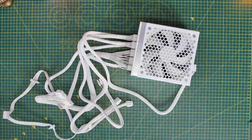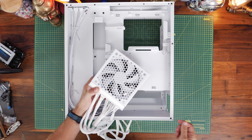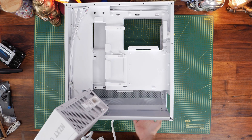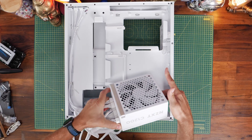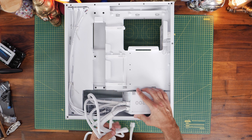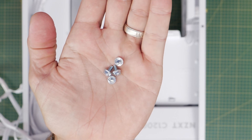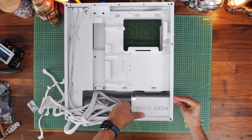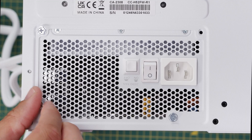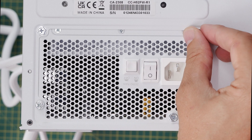Normally, you'd plug your power supply unit into the case facing downwards to pull air from below. But because this case doesn't have any venting at the bottom, we actually need to put it face up — so this is an intake fan pulling air from above through the holes at the top, which is a bit of an unusual design. Other cases generally have it face down. You use the hexagonal screws included with the power supply or case, screwing into the four corners, and it should line up nicely and secure there.